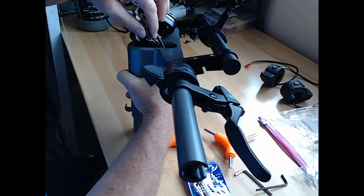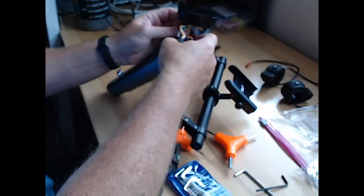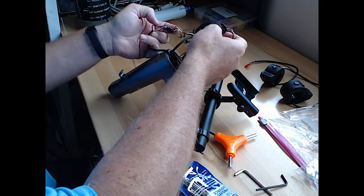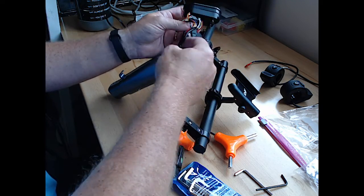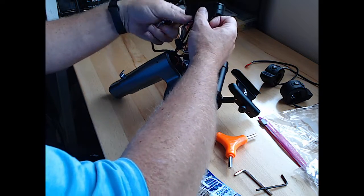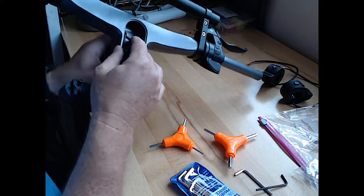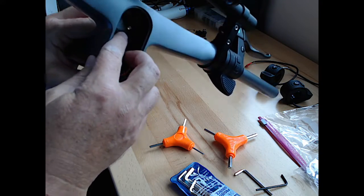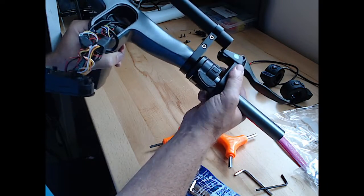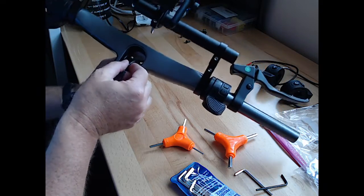And all right. So we're going to untangle some of this bundle, just so we can make our wires a little separated here. We can see what we've got going on. Because we have throttle control to each side, which is the ones we're replacing. And then there's also some brake controls to each side. All right, so we separated those. And we can see inside there's two. There are two cables that go each direction to the side. So now we can start to look at pulling this a little bit, see which one this is. Single cable, which I think is this one, going to the brake.